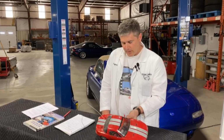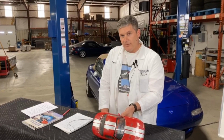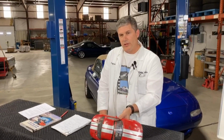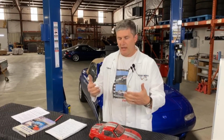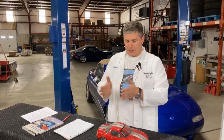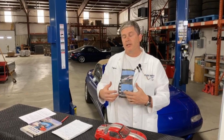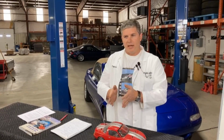Of course, if things get too hot, we get into fade. And there are different kinds of fade, and it's important to determine which one you have so you can address it properly. One is pad fade. That's where the pad gets overheated. It simply cannot deal with that level of temperature, and I'll get to that in a moment. Pad fade feels as if the pedal feels good, but your pads are bricks now. They've turned into pieces of wood. They're not doing squat, and that's because they've overheated. They've lost their friction. And if you want to deal with that, you need either pads built for higher temperatures, or you need better ducting. But that's what pad fade feels like.